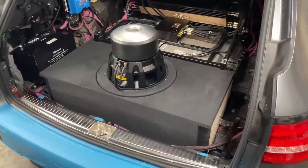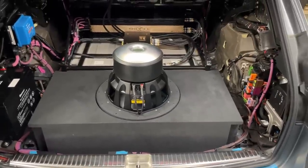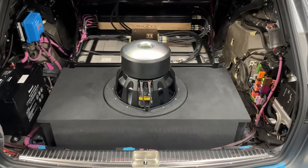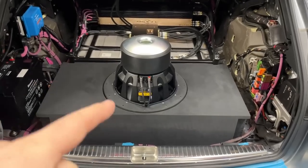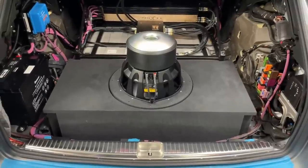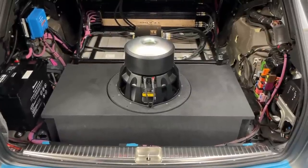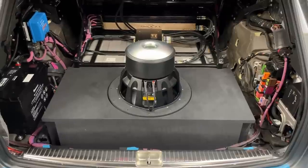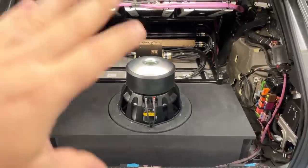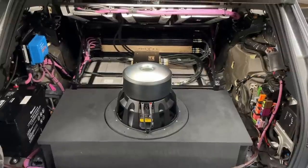And we will have plenty of power on it because we changed our mind. The original plan was to use the existing amplifier the customer had, which is a Zapco 400.2. But the coil configuration of this sub is a bit tricky. It's dual 1.5, resistance on it is 1.1, 1.2 ohm each coil. And that could be a bit of a stress for the amplifier. So we decided to actually run two monoblocks. We will talk about that in the next video, talking about the full wiring of this build, because it's pretty crazy. We are close to having it finished.